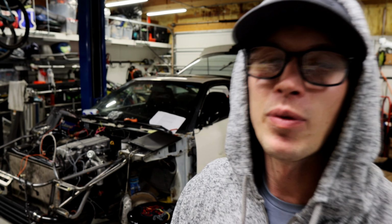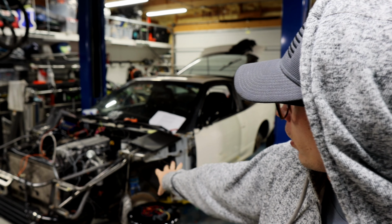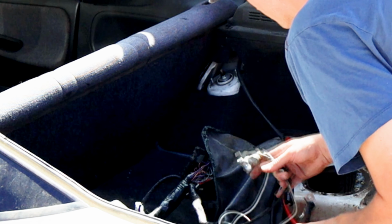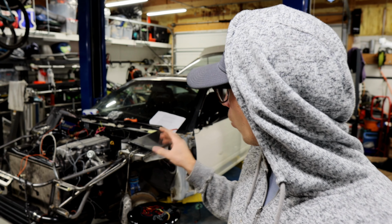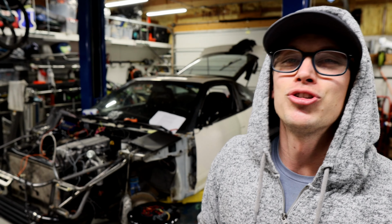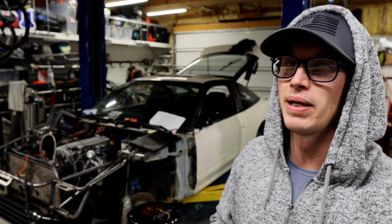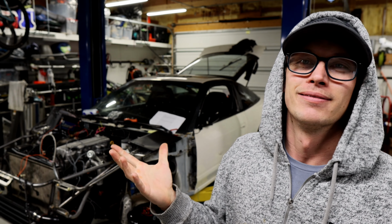So today we are going to rewire the coil, which is down on the frame rail now because the entire car was rewired to move all of the relays to the back. Again, that guy, not me. I need to figure out what's going on with the coil wiring. So I ran down to the junkyard. I found a D21 that had the correct pigtails so I could just make my own harness basically and get rid of everything that guy did because it's not working.